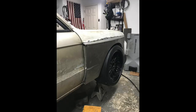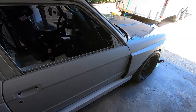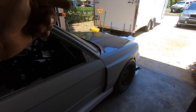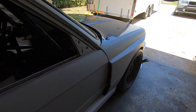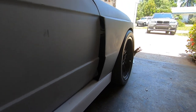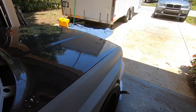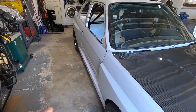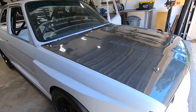The rear suspension is still E30. For the body, these are all metal fender flares. I was super inspired by the Volkswagen TCR cars — my buddy Nate races those around the United States. They have these wild cutouts on the front and rear, but I wanted to do a more subtle style, so I just did a little vent. Everything is in primer right now and this is just a rough copy — these are going to be plugs for fiberglass molds so I can replicate them.